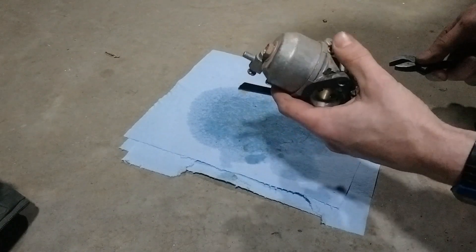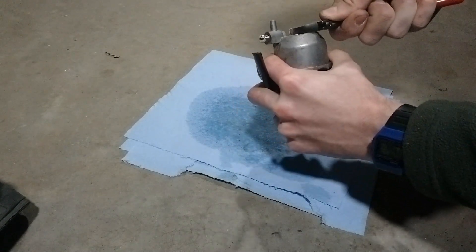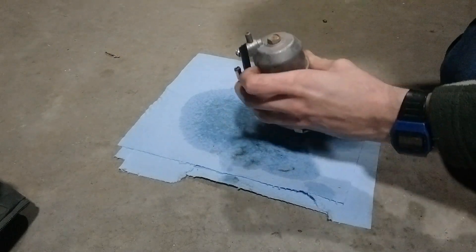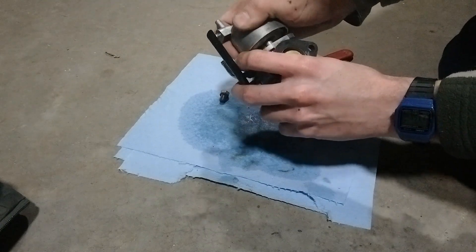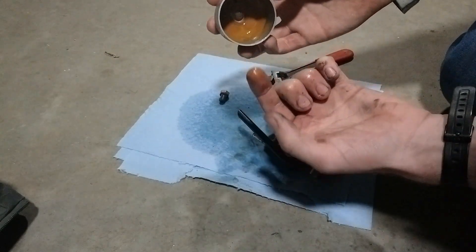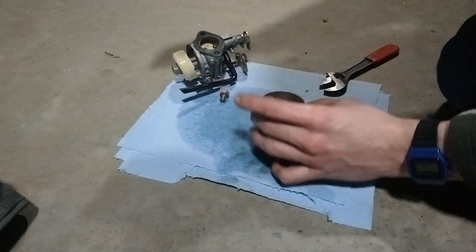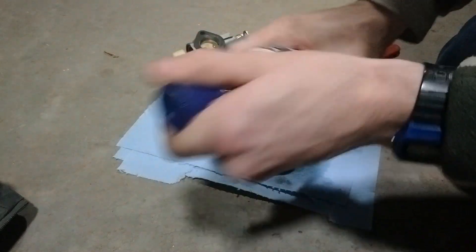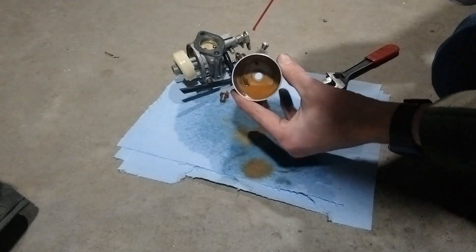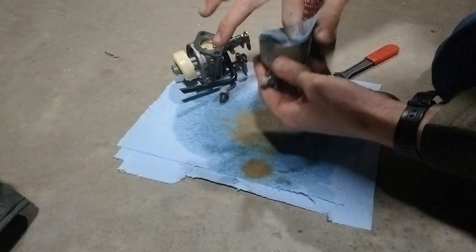The first thing you're going to do when cleaning a carburetor like this is take off the bolt on the bottom of the bowl. They may be pretty tight so you need to put a little bit of oomph into it. Take this bolt out and then remove the bowl of the carburetor. Now that in there looks pretty dirty — that's all rust in there, which means a little bit of water got in this thing at one point, which will probably explain why it's not running very well and difficult to start. I'm going to take some carb spray here. Yeah, look at all that dirty liquid in there — you do not want that inside your carburetor.